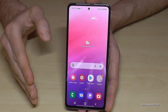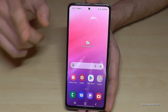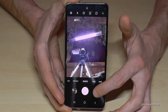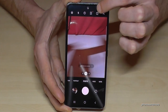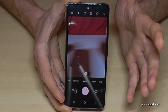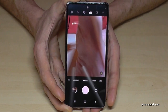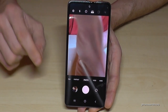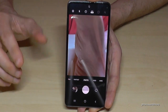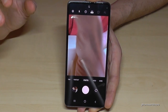For the camera — did you know you're not using the full 64MP by default? You're just using 16MP. Open the camera app and tap the ratio button (3:4), where you'll find the option to switch to 64MP. The trade-off is you cannot zoom in and you have to hold the camera very steady to take pictures, but you get the full resolution.